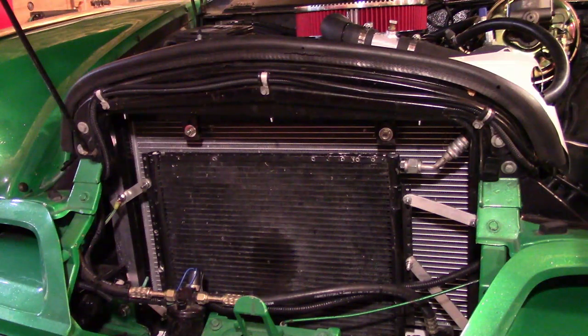The first two fans I'm going to talk about are the clutch fan and the flex fan. The clutch fan has that big aluminum hub in front of the fan — that's a thermostatic clutch controlled by engine speed and engine temperature, transmitted from the air that passes by the radiator. Even when the fan is disengaged, it still spins at least 30 percent.